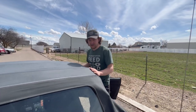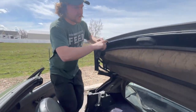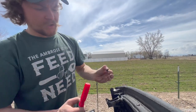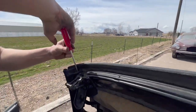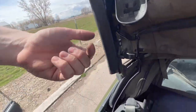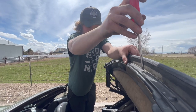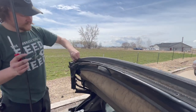Now we're going to go ahead and remove the header rail, so we need to pull the top back to get access. This is the header rail right here — you can see it's held on with a bunch of Phillips head screws. We'll also remove the four screws, two on each side, that hold the rubber weather stripping on. These screws are the same so you can't mix them up — they do have plastic washers on them. Now we can pull our header rail off, and the top is free from that.